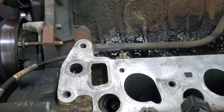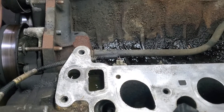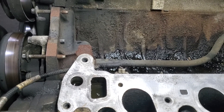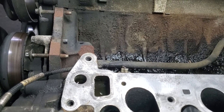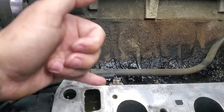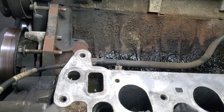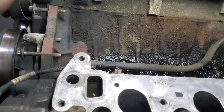It got me today, so this is our second time on and off. We do intakes on these three or four times a year between these and the trucks and the Expeditions — never have we had this issue with lean codes popping back up over these dowel pins.